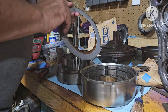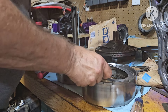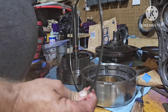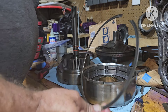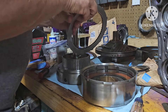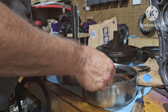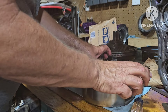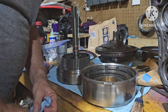I've already put this together and checked the clearance. With all brand new friction discs I measured 97 thousandths, and that was without the wavy ring being compressed, so I could probably add another two thousandths — and the bottom end of my tolerance is 96 thousandths, so I'm within specs. Now we're gonna put in the steel that Damien from First Responder Garage gave me — that's number four — and this is also the friction disc he sent me, number four. So now I have a four-disc friction pack instead of three.